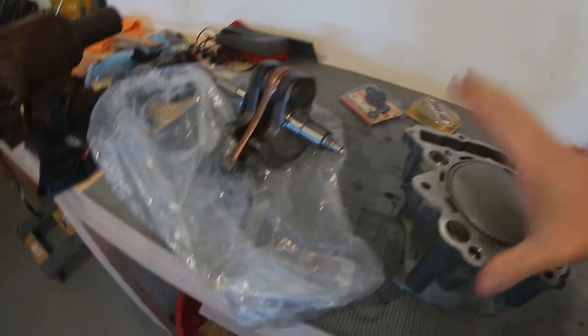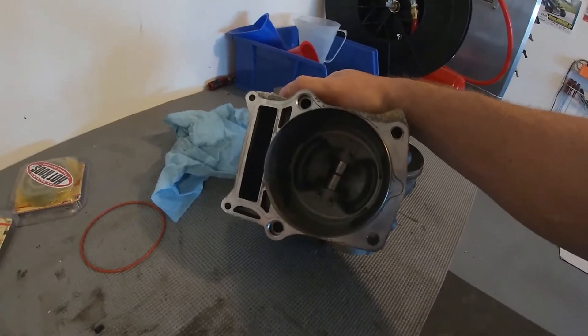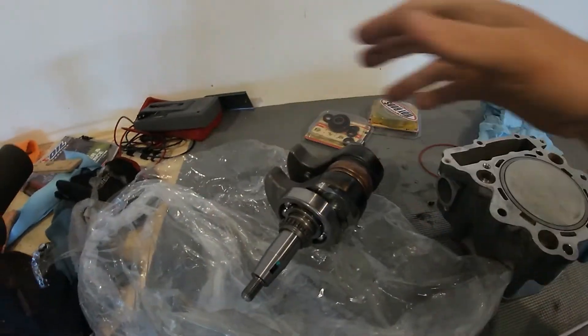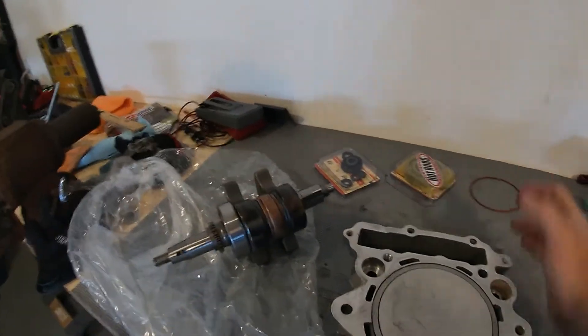There's the new piston, and I just still need to find a decent top end for a decent price. Some people say you can fix them, but I'd rather just get one that's either used or brand new. The brand new ones are pretty expensive, so OEM is probably out. I'm going to try to go used. I think I'm going to go with the Hot Cam Stage 2 cam and chain. Obviously, you're going to have to put different valve springs in and things like that as well. I think that's the route we're going to go once we get there.